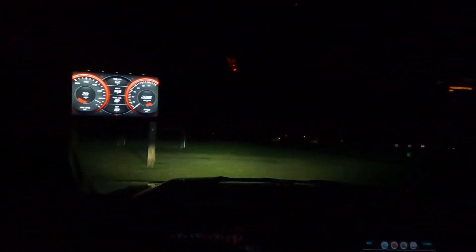I'm always looking at ways to improve and make the truck a little better. Two things hopefully — because with the way the economy is you never know, and I'm trying to get some other stuff paid off. But hopefully I'll have enough money banked up in the next few weeks and I'll be ordering my new transmission pan. It has a step so you don't have to jack the exhaust up or unbolt it from the manifold to move it when you do your transmission fluid change, which I've already done once and got a complete transmission bath.